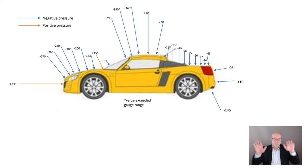This is all attached flow. The flow is flowing along the surface of the car. But remember back here, there was separation. In fact, we saw that big separation bubble. Low pressures, but as the flow starts to reattach, the pressures increase. They're not as low, if you like. You can see that pattern because the length of the arrows is proportional to the pressures.